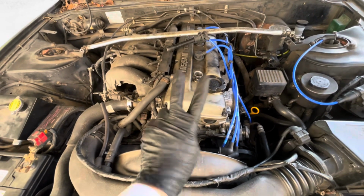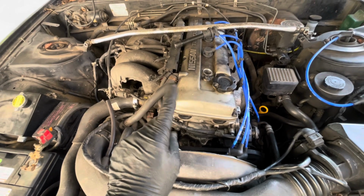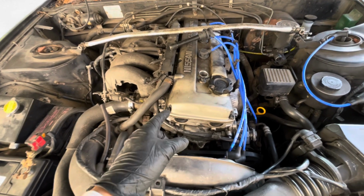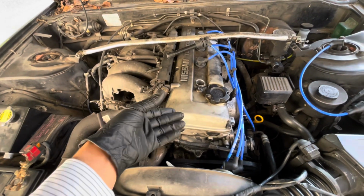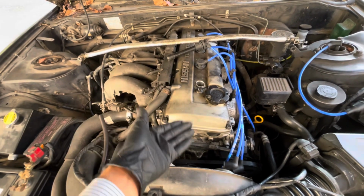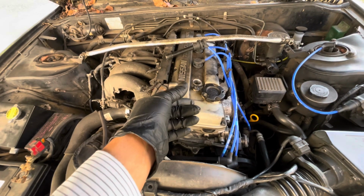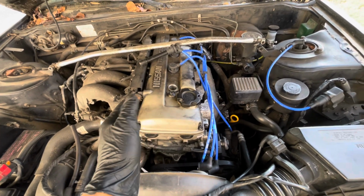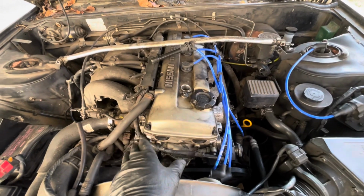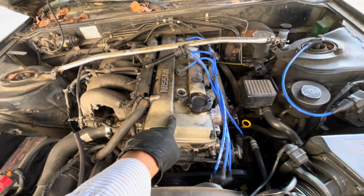So I learned something. Apparently there is such a thing as 2 different top dead centers. One of them is the intake, or also known as the compression stroke, which means the lifters on the intake side opened up and are allowing air to go inside of the chamber, and it's compressing the air. And there's also a second time the stroke is going back up again, where it's the exhaust stroke, which is allowing the air to go out. Apparently the intake slash compression stroke is the true top dead center from what I've read.